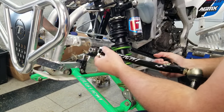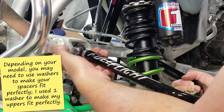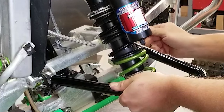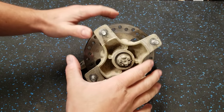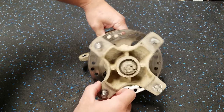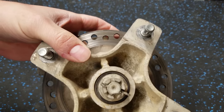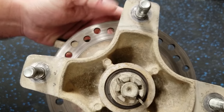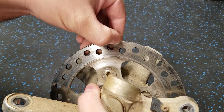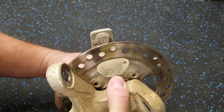Now we'll put the uppers on - I'm going to make sure that these are oriented correctly. Before we put on the spindles, I've got to address these - they look like crap. We can't be putting these crappy things onto a brand new set of A-arms, that's just not right. I'm going to be replacing these discs anyway - let me see if I can find the cracks in them. See, it's splitting right there. They're not grooved out that badly, but the cracks - I'd rather just replace them while we have this off.